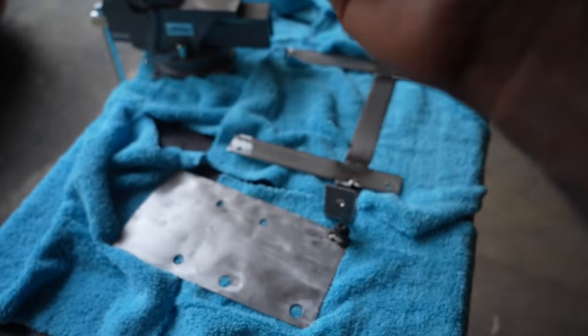All right, this is the solenoid. This is where I placed the solenoid. You can see line in and line out. The tube that comes from the pump, we're going to pass it in there, and then it goes out and goes to the charge pipe. Now, notice that I placed the solenoid up here on the engine bay. The reason I did that is because we want this to be as close as possible to the nozzle, because we don't want the liquid that is in the line to be too far from the nozzle, because if that liquid goes into your engine and the engine is not working or whatever, we don't want that to happen. It can cause some issues in your engine.